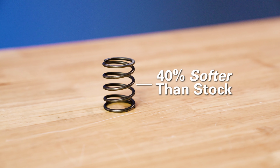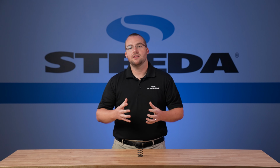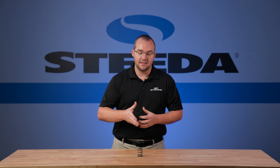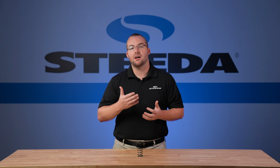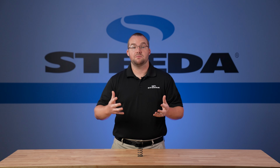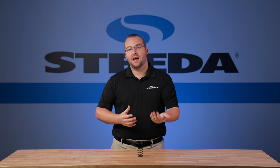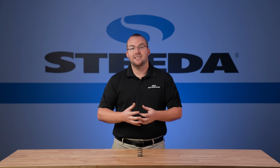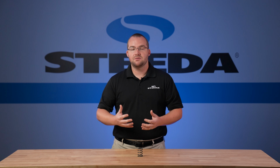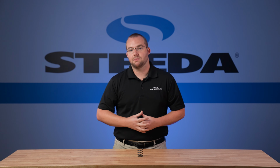With the Steeda clutch spring, we decrease the rate by about 40% compared to factory. What that means is, as the driver, you're going to feel a lot more engagement with the clutch pedal in your left foot, which makes, again, for a more pleasurable driving experience. Having that feedback in your left foot makes it a lot easier to shift through the gears and gives you a more real, live feel of what the clutch is actually doing on your Bronco.